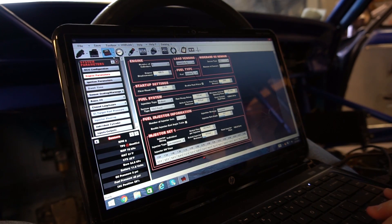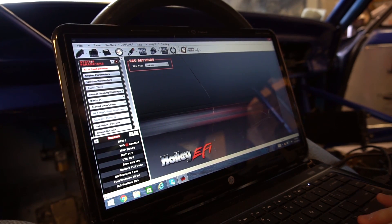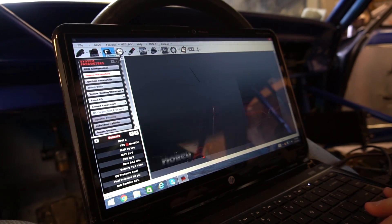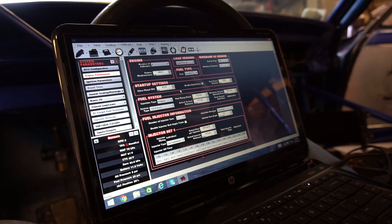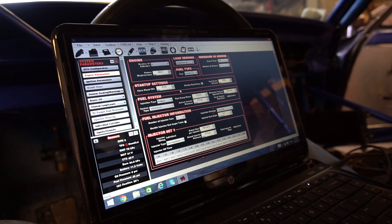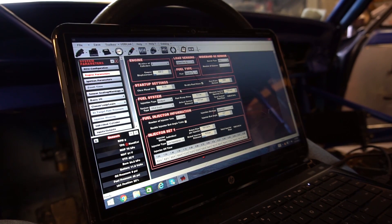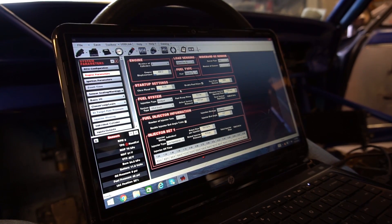Under the main tab here is the ECU configuration - Dominator, which it automatically picked up when I tied into it. Mine has a fuel prime time, but yours seems like it's on all the time, which is weird. Mine would usually only prime for about five seconds and then turns off. But once it sees ignition it just turns the fuel pump on - and that's fine, because it's a continuous circuit so it's not backing up against anything.